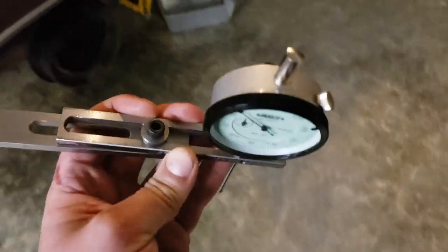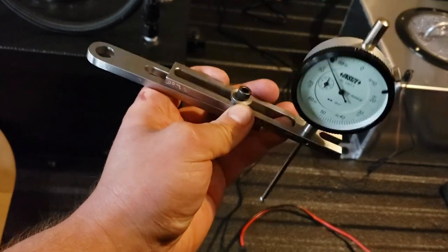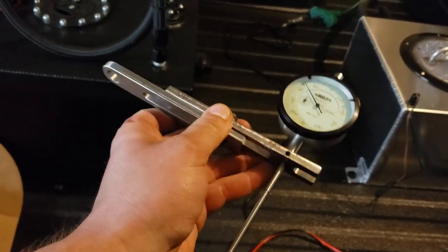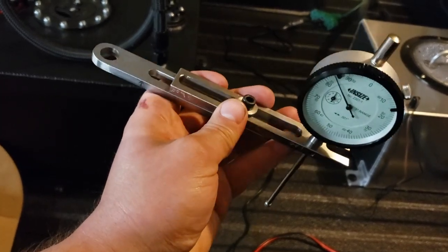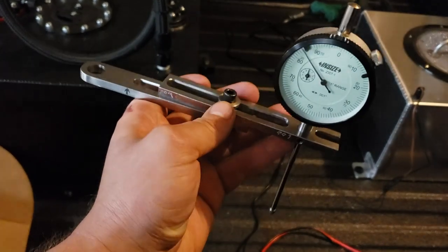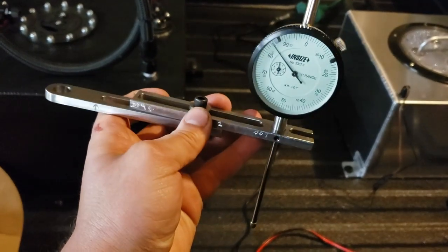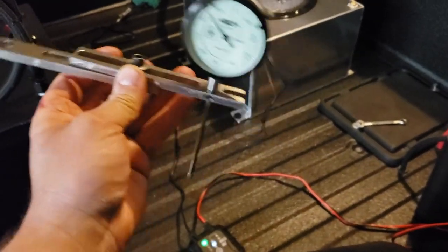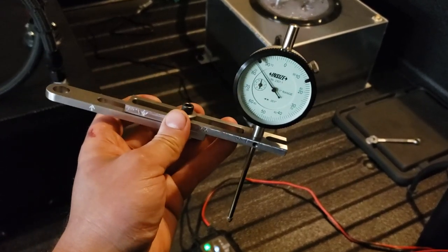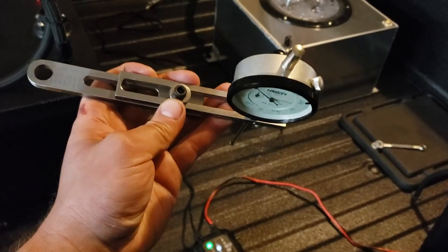The tool is made — this is our ring and pinion installation tool. You need to check pinion depth when doing a ring and pinion change, and instead of buying a tool, my co-worker and friend David, a genius fabricator in the machining world, said let's go build one. This looks like a simple item but you want to be super precise with pinion depth, and this has been machined to a one-thousandth-of-an-inch tolerance side to side. You can get them online for about $100 but they're made of aluminum and they're cheap — this one is amazing. Big thanks to David; he did all the work.